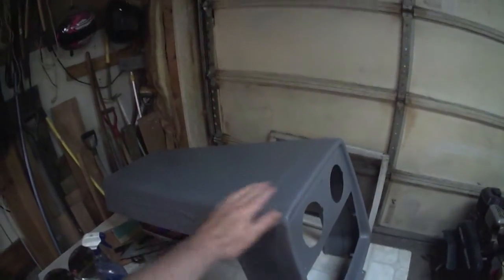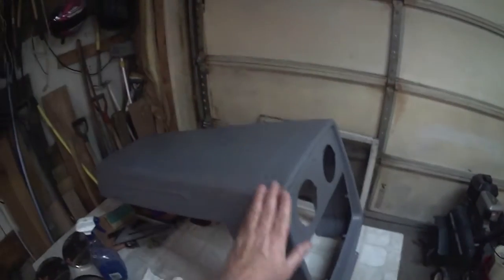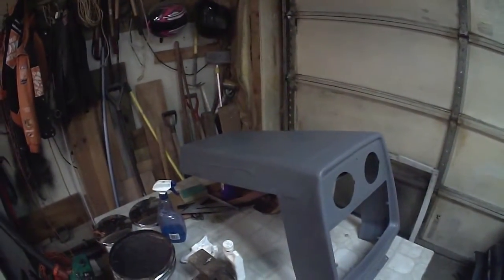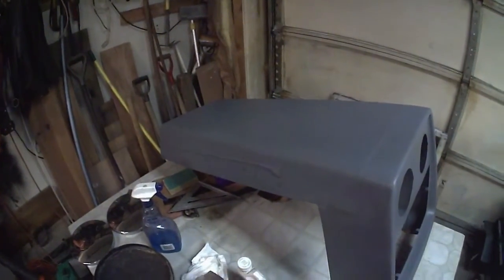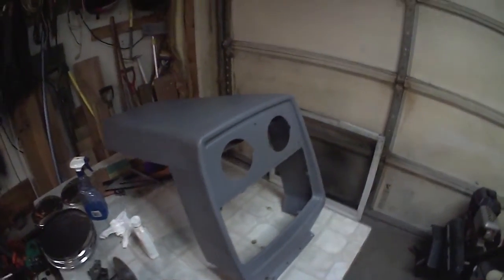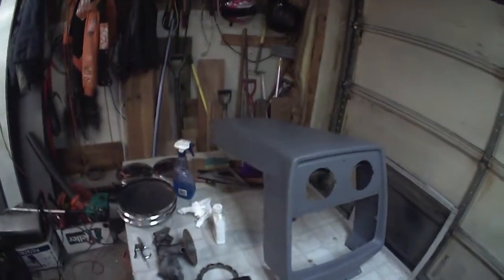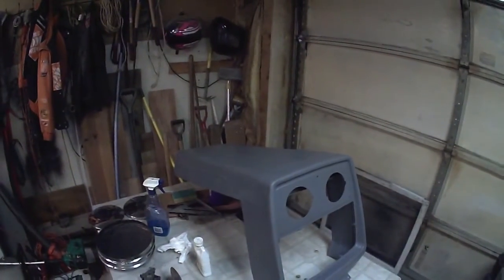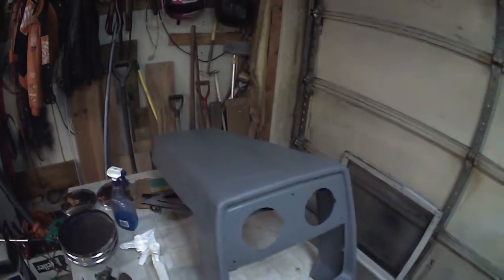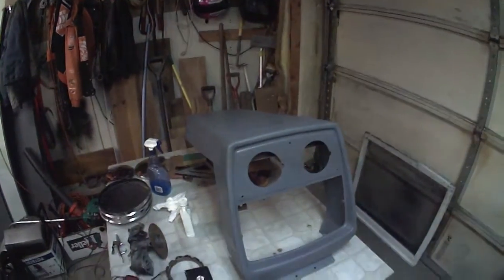No turning back now. I'm not happy with this primer but I knew it was crap when I put it on - I sanded it down and I didn't want it to rust. The reality is the garage is pretty dry, I always have the air on so the humidity is very low in here. But I did not want to take the chance, so I went ahead and hit it with the cheapest primer I have so that I can sand it down again and kind of see where the high spots are and try to decide if I want to do anything about it.